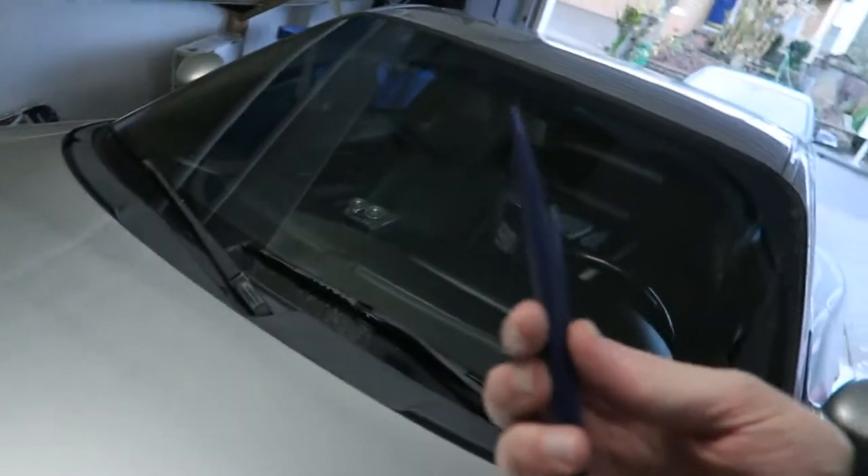What that involves is these plastic trim tools. I do not recommend this method if you have an M3, M4, or M5, but I do recommend it for the 335i or 340i with the M Sport steering wheel because the buttons pop right off — you do not have to take anything off the steering wheel. I highly recommend using plastic trim tools, not metal tools, to avoid scratching your interior. I'll leave the link in the description — they're about 10 to 15 dollars and come with about eight different tools.